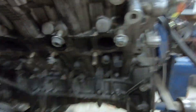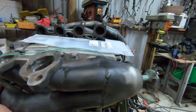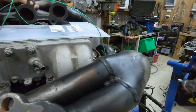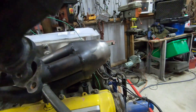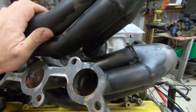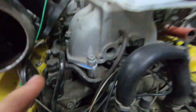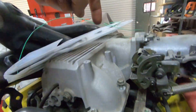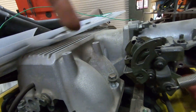We know that the exhaust manifolds are the same, so the exhaust gaskets are the same. Here's a set of my headers — I can take a set of left-hand headers and put them on the right-hand side, and right-hand headers and put them on the left. The intake manifold can be reversed. The intake manifold gaskets are the same on both sides. You can also swap the top of the plenum as well — you can swap the bottom bit around and the top.